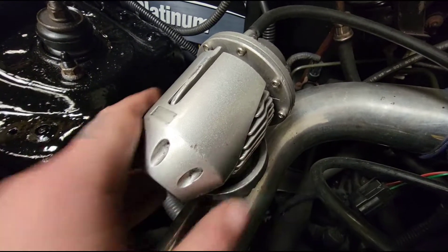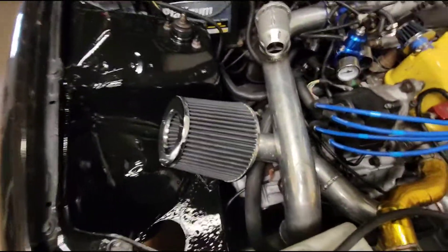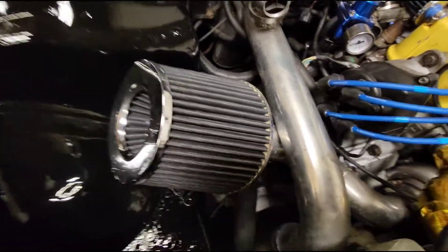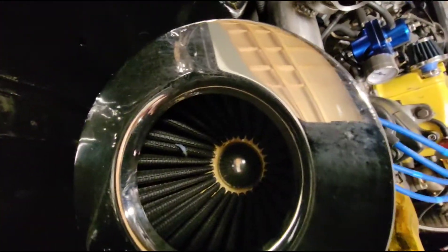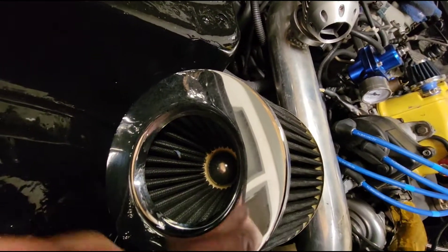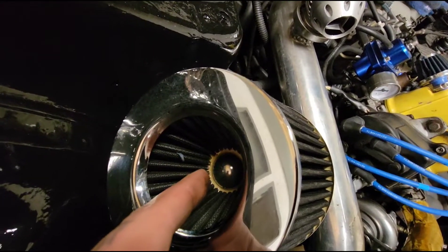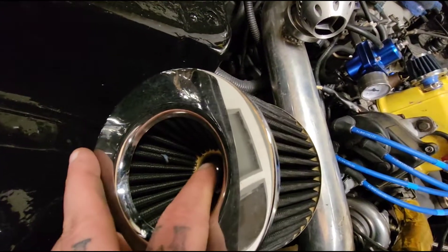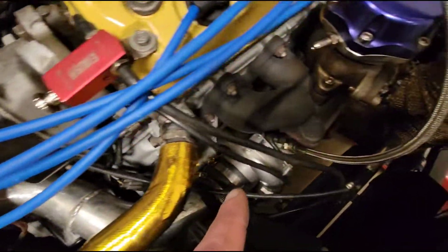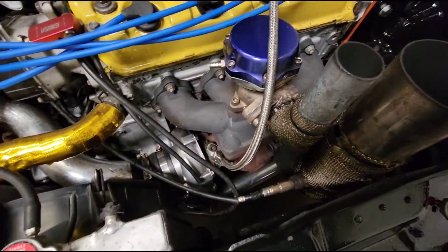Another thing to keep your eye on — these cheap air filters. I've talked about this before and have been told by people that it saved them a great deal of hassle. See this little chrome piece inside in the middle? Usually on the inside they super-glue it, but as soon as it wants to come off, it's going to go through your intake pipe and destroy your turbo.